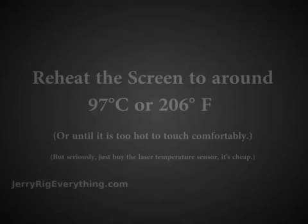For those of you in the future who are going to attempt this without a temperature sensor to tell you what temperature the phone is at, you're going to want to heat it up to the point that it's too hot to touch comfortably. You won't be able to rest your finger on it for more than maybe a second at a time, and then you'll know that the glue between the glass and the LCD is ready to be separated.